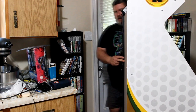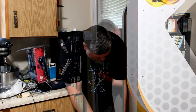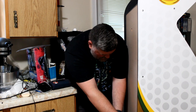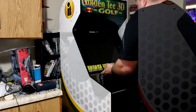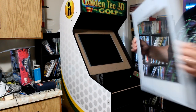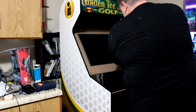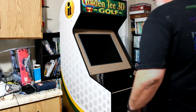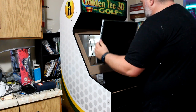Next, we're going to take out the Golden Tee 3D cabinet and start getting it ready to mod. Unlike other cabinets, we don't actually have to take the full thing apart — you only have to take the back off to access and remove the cables. Once that's done, take off the control panel and remove the bezel, giving us free and clear access to the screen, which we can just unscrew and take out without dismantling the whole cabinet. I was greatly appreciative of that fact.